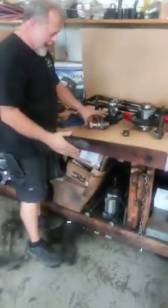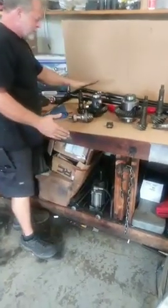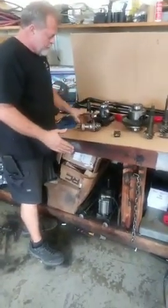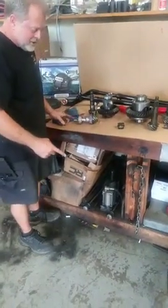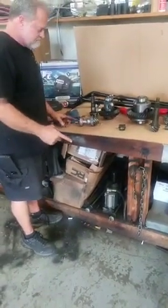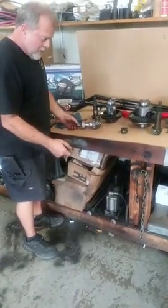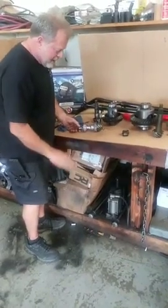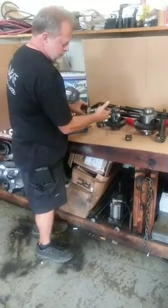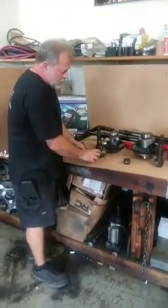At about 18 inches out with a wrench, the average preload, it's a little more when you get up to a differential like this, but the average preload on a Dana 44 or a Dana 30 at 12 to 18 inches, I want to see somewhere between, let's just say an average of 15 pounds, which means basically at this far out, 15 pounds with just a finger push down will move this bearing in rotation. That's how much resistance you need. All right? So that is called preload.